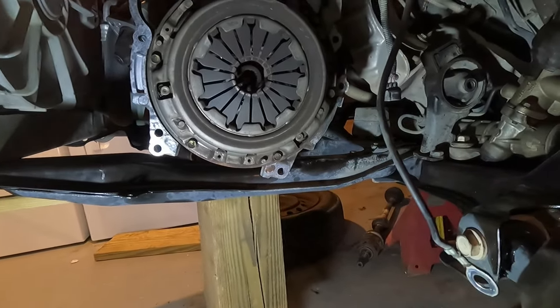Got the tires on and all the stuff associated with that - axles are in. Next is just finishing up the last few things up underneath the hood, clips and whatnot. Need to bleed that clutch too - I'm here by myself so I'll just open the bleeder and let it gravity bleed for a minute, then get it off the jack stands. Still have to do the shifter clips back there in the back, but getting there - working on the top side now.